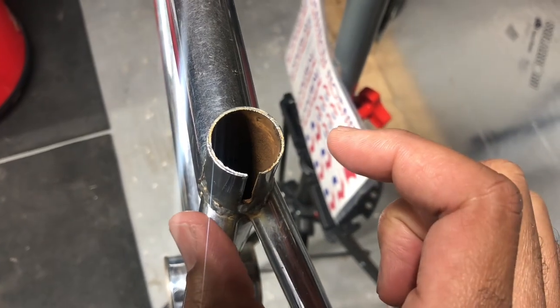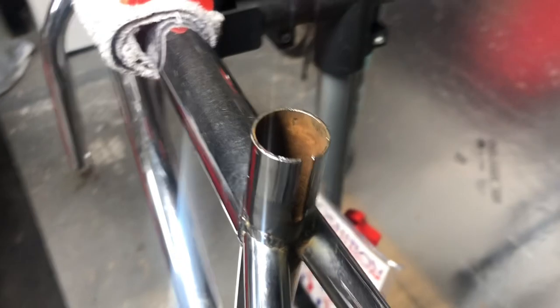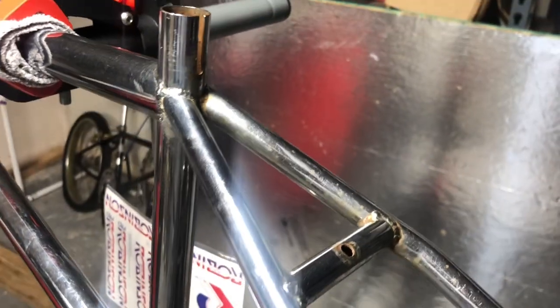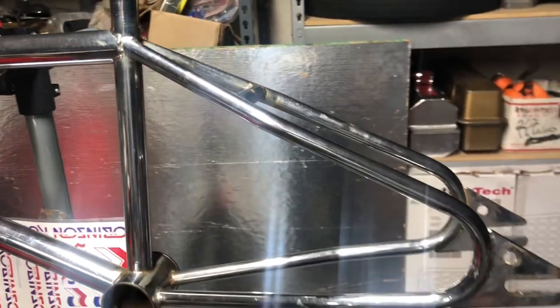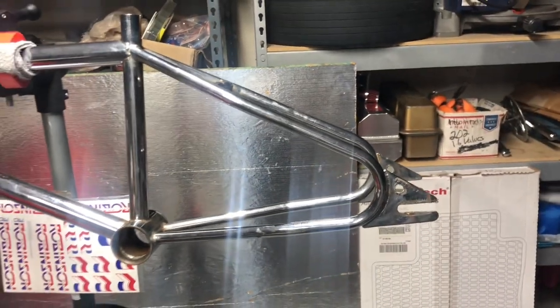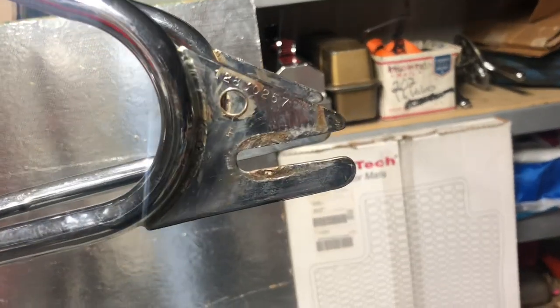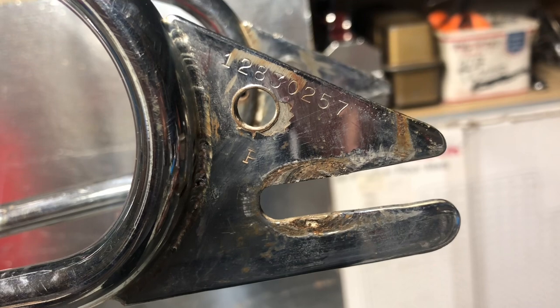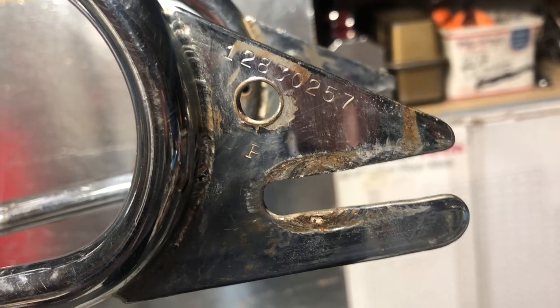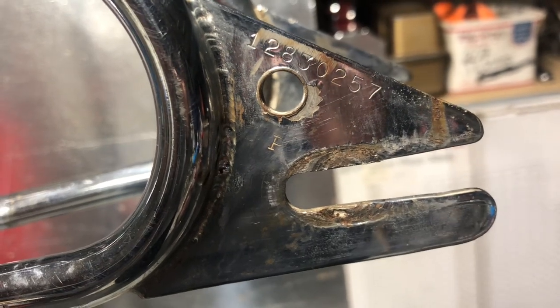Make sure that tube is a perfect circle. If it's crimped — meaning pinched a little bit — you might have a hard time putting on a seat clamp. If you want to roll the dice and get that bike, make sure you get a hell of a deal for it. If there's anybody in the market for this bike, pay attention to this area. You have the serial number at the top, then there's a circle with a P stamped there — that P stands for Pro.